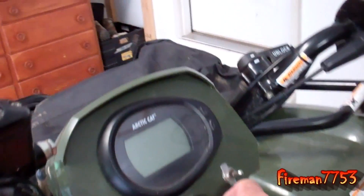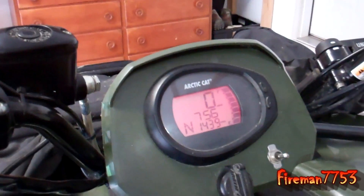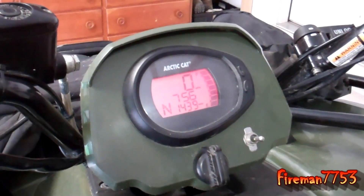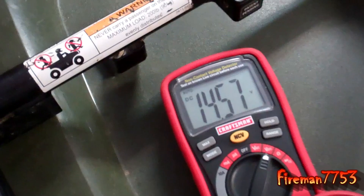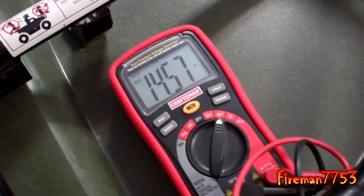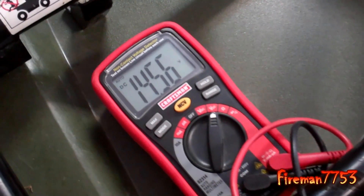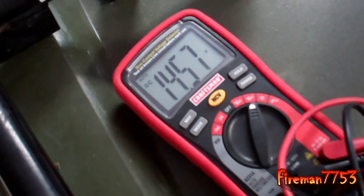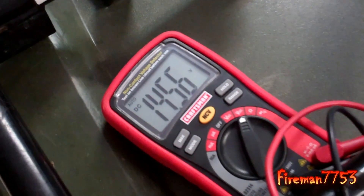Alright, so we've got everything put back together, battery hooked up and everything, and now comes the moment of truth. We're going to start it up. So now we're going to get our voltmeter out and do some tests. Our voltage is remaining fairly constant when I idle it up. What it was doing before is the voltage was just all over the place — it would drop below 12 and go up to like 15. Right now, if I rev it up and let it back down, the voltage only changes by a few tenths, so I'm going to guess that fixed my problem.